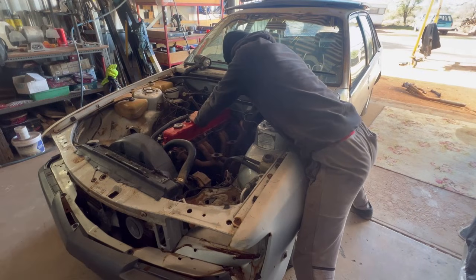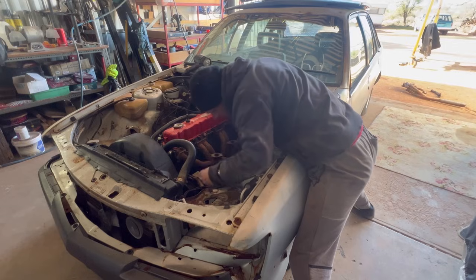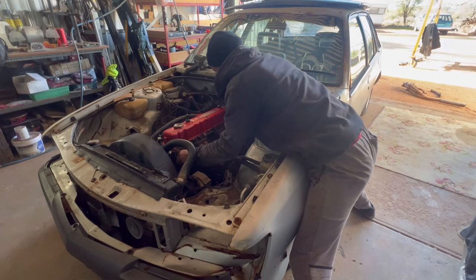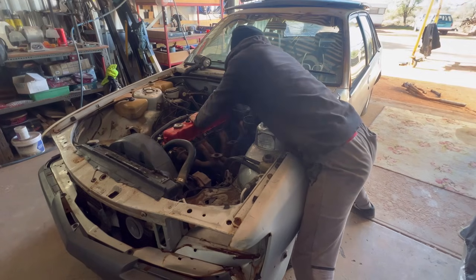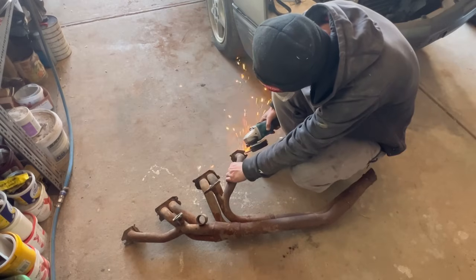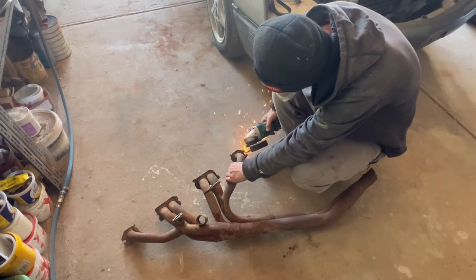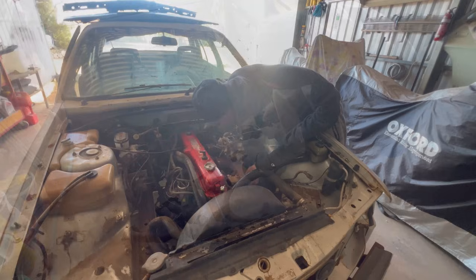So hopefully your extractors won't come out in two pieces like mine did. Mine were actually snapped and held together with a beer can and some hose clamps. Aside from that fantastic fabrication work, I realized at this point in time that the car was actually too low and my lower back was absolutely killing me. Aside from that, the rear bolt wouldn't line up, so I had to open up that cutout at the end of the extractors a little bit.